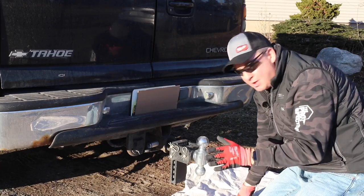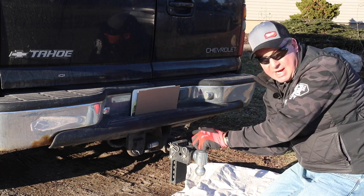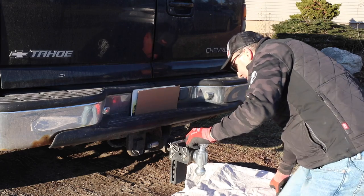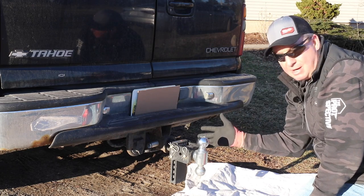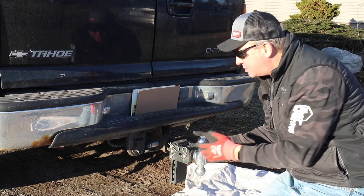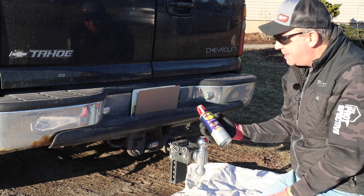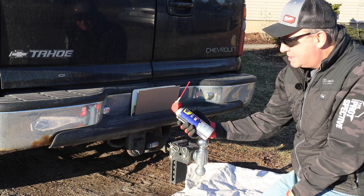Now let's go over to the towing vehicle. Looking over your hitch, take a look at everything and make sure it's in good order — look for any stress cracks. I had a new truck one time where after a couple of years I noticed the ball starting to sag down a little bit. Underneath you could see where it was starting to have a couple of stress cracks, so I got it replaced right away because once that starts happening it's going to go. If you haven't taken your hitch off, I recommend removing it to see what it looks like — sometimes they get so rusted in that you can't remove it easily. Put something on it like this rust prevention product that prevents rust up to one year and provides 12 times longer lubrication.